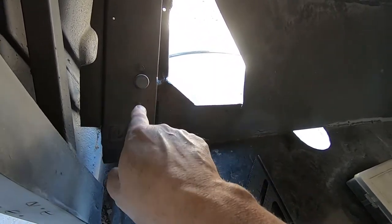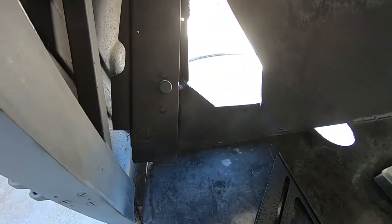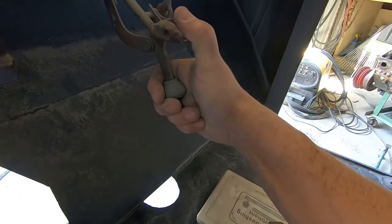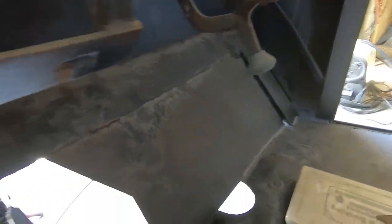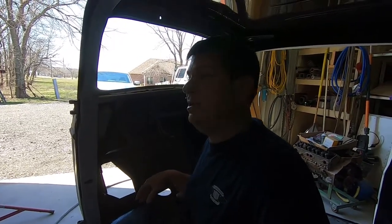And then, ooh, how many of you know what that is? Probably everybody that watches my channel knows what that is. I freed up the vent piece here. That bolts in underneath the dash, but it's welded to the firewall because I don't want any bolt holes showing there. And yeah, that gets the inside all cleaned up, welded up, and prepped so when we do our final priming operations, we don't have to worry about anything being in our way.